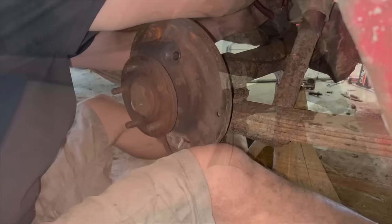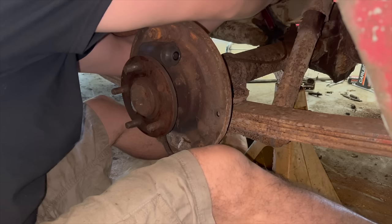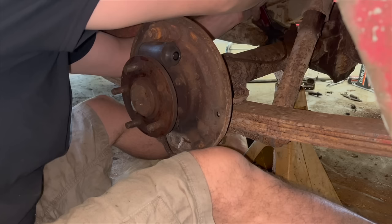So I'm gonna go ahead and cut the rear brake hose, so that way if this one's wrong, we're absolutely up a creek, is my plan. I'm hoping that it unscrews out of this junction block. I've had some trouble with that before too, where they didn't unscrew. You had to buy the hose that has a junction block in it. There we go. Okay, good. It unthreads out of there. Good. Okay, I think we're all right with this one. Now I just got to get it to come loose from the brake metal line up here and we'll be okay.